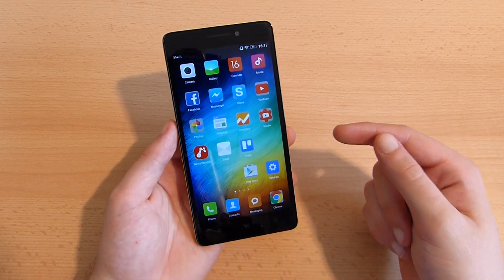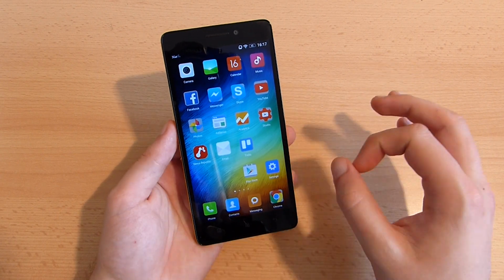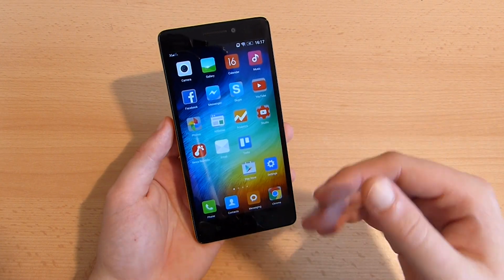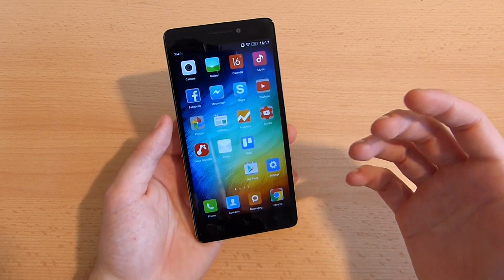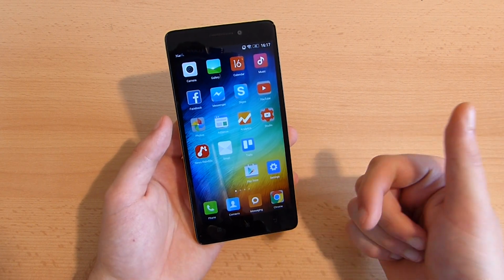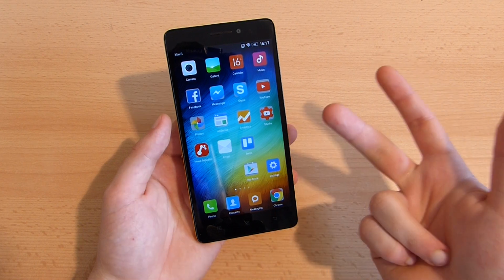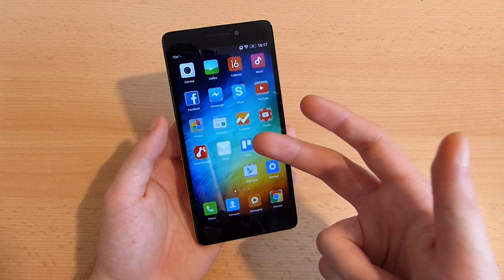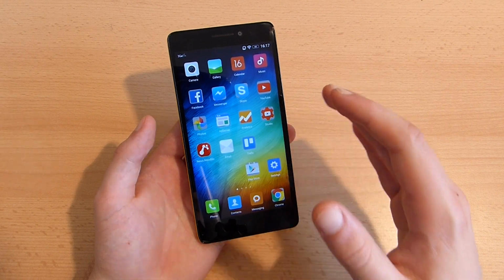So if you get a phone pre-installed with multiple languages and the Google Play Store, please make sure to remove it and install the proper stock ROM, because those shop ROMs may seem useful due to the pre-installed Play services and the multiple languages on it, but actually those ROMs offer way too much bloatware. There also are viruses or adware on it, and the ROMs don't perform as well as the original ROM does. It's pretty laggy compared to the original ROM. So please install the proper ROM before you use your phone.